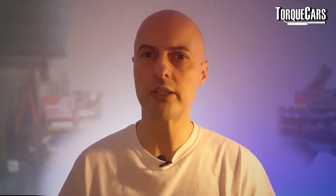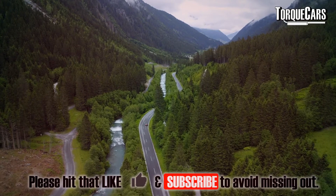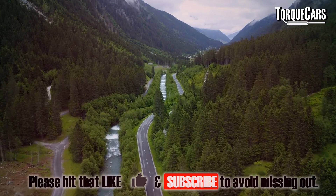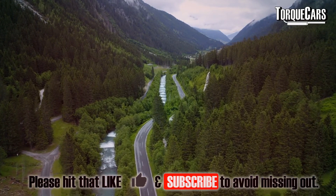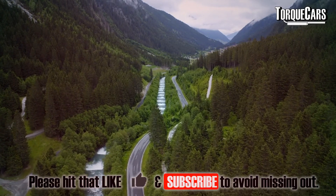On a road car you really want the economy that comes with having a flywheel and gradual changes. When you come up to a hill you want the car to keep its momentum going. If you fit a lighter flywheel and you hit a hill you're going to bog down — you're going to lose a lot of that momentum and you'll really have to press the accelerator harder to compensate to keep the car traveling.